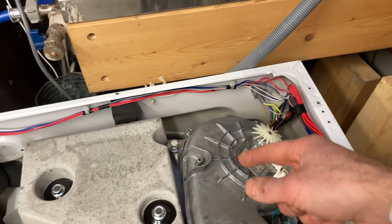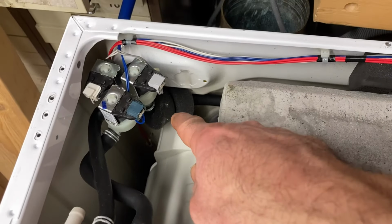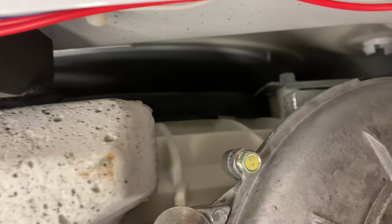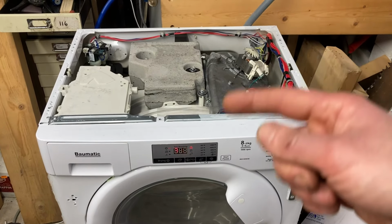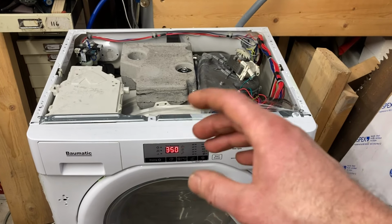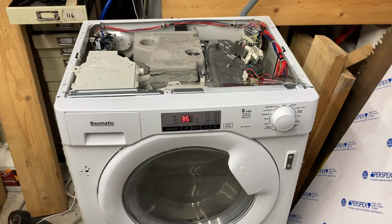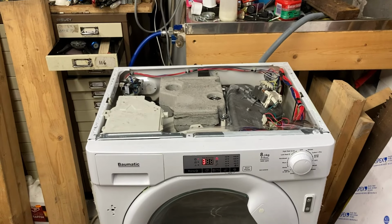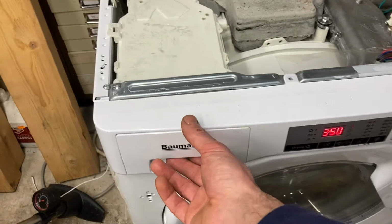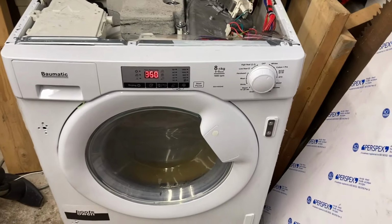So it takes the air, heats it, or spins it around, or blows it over a heater down the front, and then there's another pipe coming off here for cold water that goes down there, and I think there's some kind of a condenser unit where the steamy moisture-filled air that's circulating through periodically gets a trickle of rainwater, basically, that captures the moisture out and then pumps it out the pump at the bottom. And so these washer dryers don't have a lint filter the same as, well, it's taking on more water for God's sakes. Oh no, it's taking on a bit of water, but this fan has just commenced, so it's gone into a drying cycle.